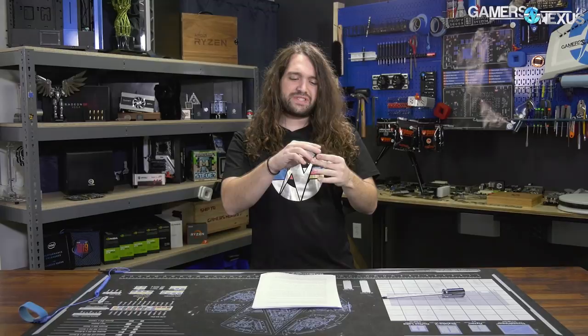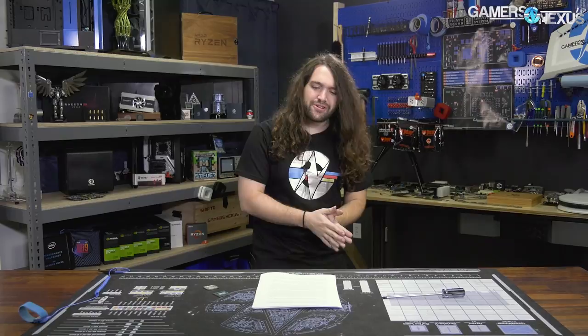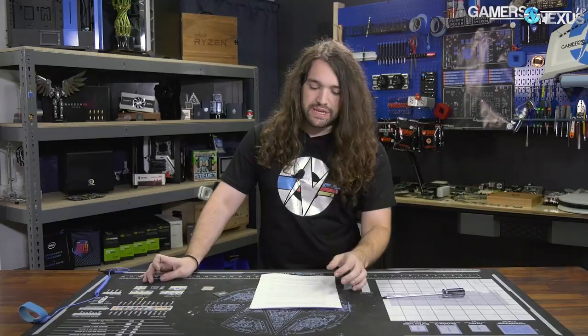The first thing to start with on this new CPU is the solder — which we've replaced with thermal paste. We went backwards. Intel's STIM, or Soldered Thermal Interface Material, is the company's biggest bragging point for the 9900K. They've been pushing it hard, and deservedly so — this is what enthusiasts have been complaining about for years. We de-lidded the 9900K, removed all the solder, and replaced it with Thermal Grizzly Hydronaut thermal paste to see how a high-end paste compares to solder.